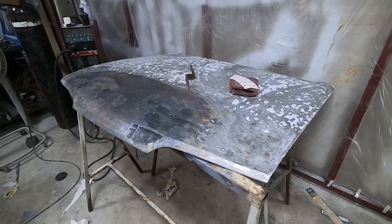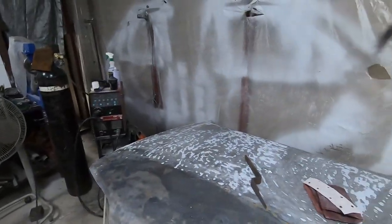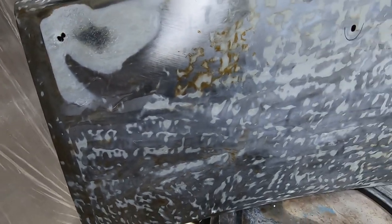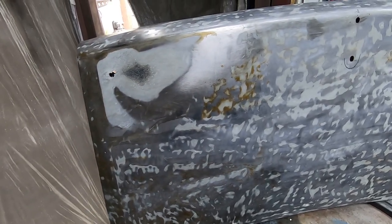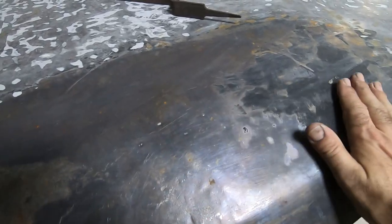It's bonnet or hood day. It rained pretty hard last night and all the sheets covering the doors were wet, so I've had to remove the doors. They'd been standing there for two weeks waiting to be painted, which isn't ideal. The boot — the trunk — got wet and now has rust on it. I'm going to deal with that quickly with some phosphoric kit just to stop it, then it'll all be sanded, DA'd and primed.